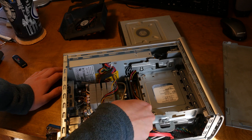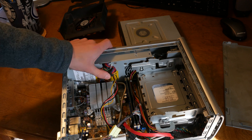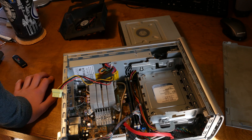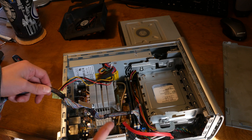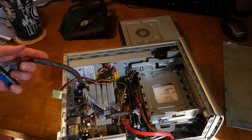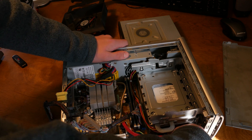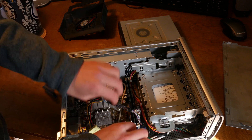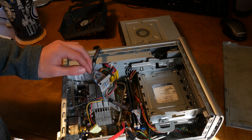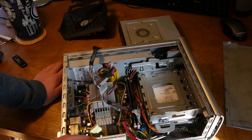Here we've got our 20-pin connector. That's an IDE connector that this was plugged into, and we've got an extra one here. Doesn't look like we have a 4-pin, so not much power requirement in this one. This right here is a PCI slot, not a PCI Express slot, so it won't be able to take the graphics card that I currently have in my other computer, but that's not a big deal. We will be able to get some expandability for something like more SATA ports if we need that in the future, because I'm thinking of maybe using this space for more hard drives. It looks like we've got two SATA ports on here, one of which is free, and then we've got the two IDE connections here. I think I have an older IDE 500GB, so I might use that.